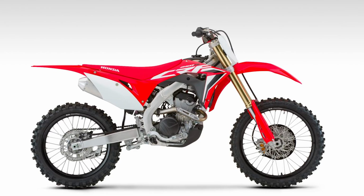It'll be interesting to see the bike up close to see how they did that with the head pipe design. They've also changed the second gear ratio, which I am really stoked on because the factory connection race bikes actually have this. Basically, one of the bigger complaints the first 2 years on the intro has been that getting from second to third felt like a huge gap. Like you had to rev second to the absolute top of the range to get into a premium point of third. You really could never shift second early and hit a prime point of power.